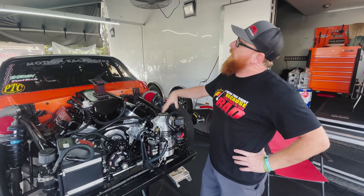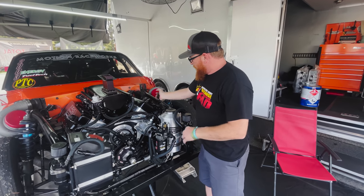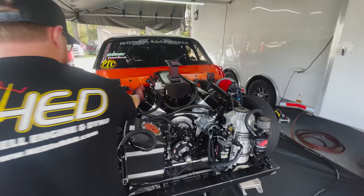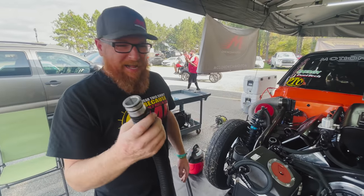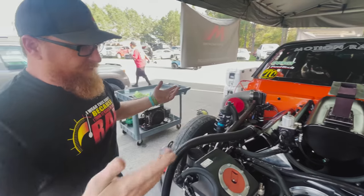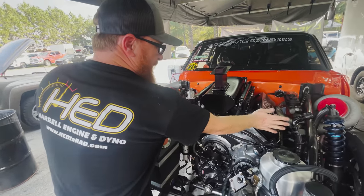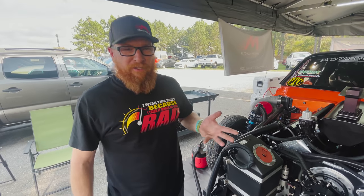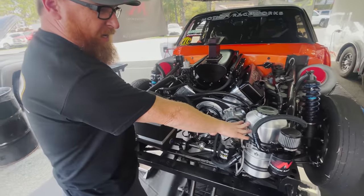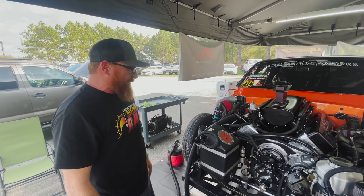It's very inefficient to cool it off that way. So we obviously hang fans, and I usually will just unclick the breather. I've got a little piece that we made to go in the shop vac. We'll stick it through there, turn the shop vac on, and it'll draw the nice cool air through this side, through the crankcase, and pull air through this side. Good thing is also it's a dry sump motor, so all the hot oil is here. It really cools the crankcase off super fast.